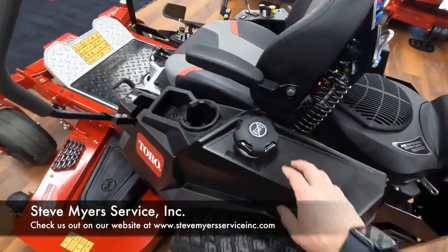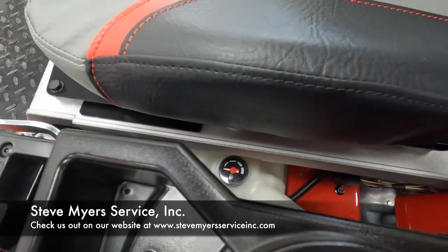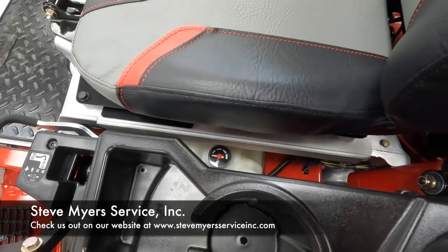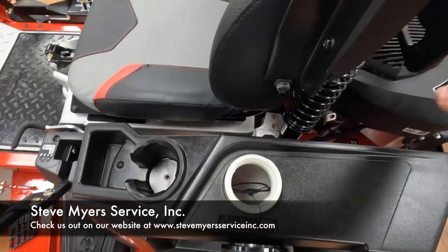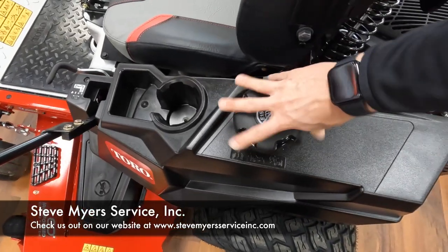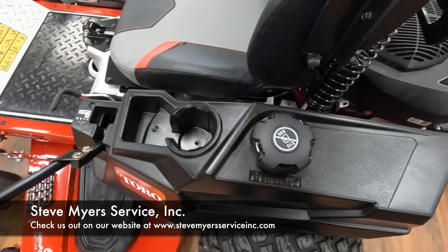As we continue to the left, we're going to get to the gas tank. If you lift up this armrest and peek down in there, you're going to see your fuel level. Very conveniently, as you are filling your gas tank, you're going to have a perfect sight picture of the fuel level. Once it gets to the top at the full position, go ahead and stop filling — we do not suggest that you top it off. The fuel tank is vented and the vent runs back to the engine, so overfilling it is actually going to put excess fuel back at the engine and could cause poor performance. The cap is a ratcheting cap, so you can't overtighten it — once you turn it down you're going to hear the clicks, and that's how you know it's as tight as it can be.